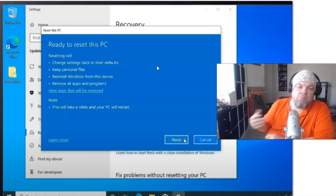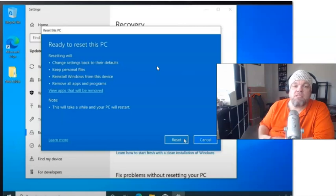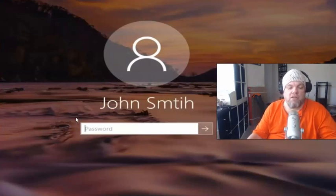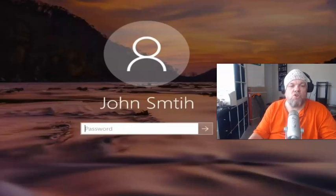It takes usually 40 minutes. Make sure your Asus is plugged in. If you want to do it from the login screen of Asus, it's pretty easy to do. What you're going to do is hold down the Shift button — it's usually in two places on the keyboard. While you hold down the Shift key, you're going to hover over the power key. Remember, we're on the login screen here where you'd put your password. Hover where it's got the power, click on it, and then while holding down the Shift key, you're going to click Restart.